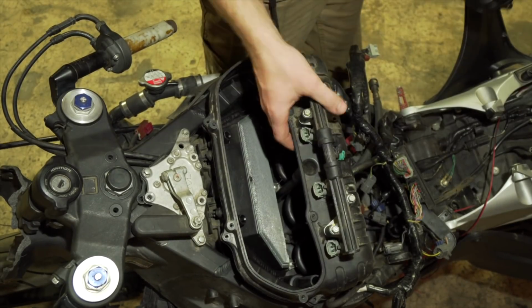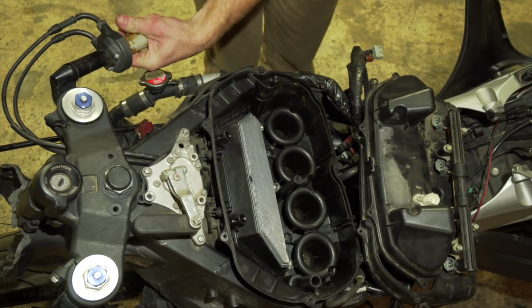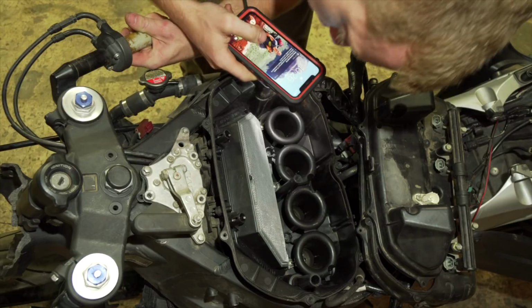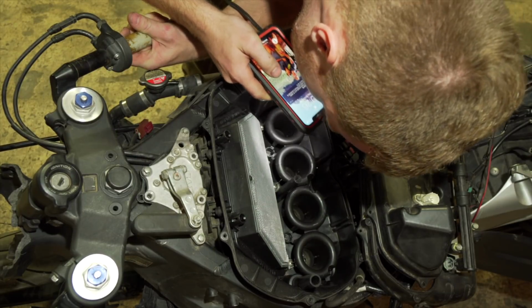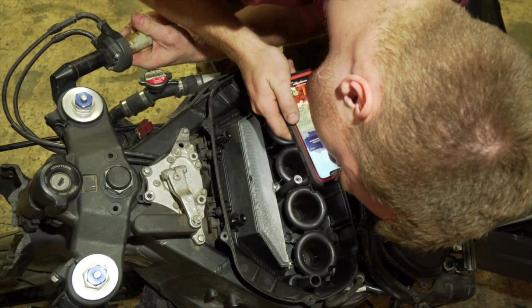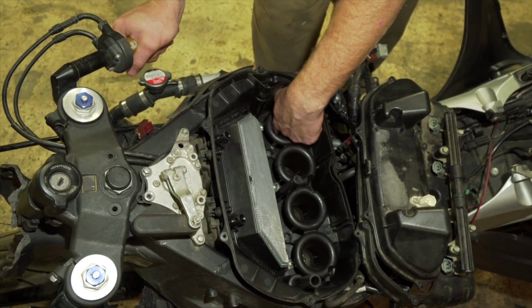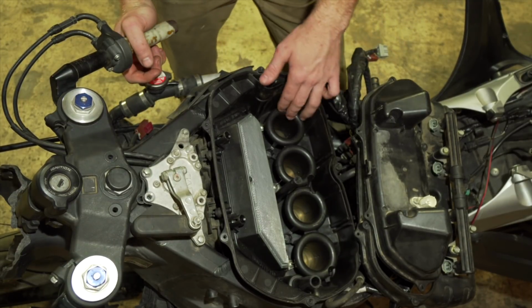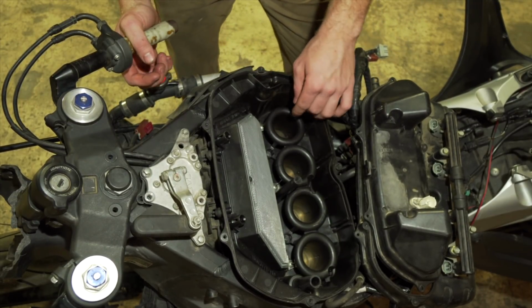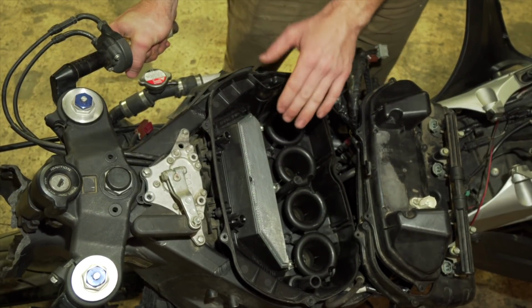So I showed y'all a little bit inside of the intake. So down here, you were actually able to see one of the valves. They looked a little damaged. Looks like it's got some damage on top of the valve. But I used the sandblaster to blast the valve because it looked like something was on the valve, but it ended up being the damage on the valve. The motor turns over and I think it still seats fine, so it might still run fine.